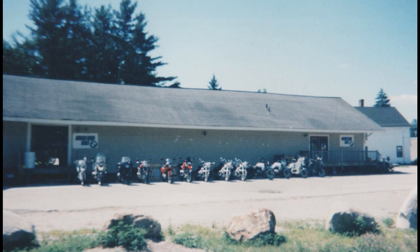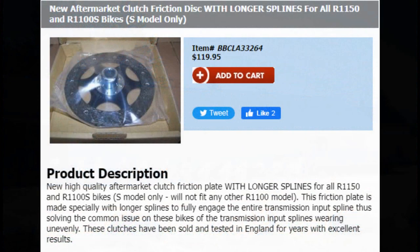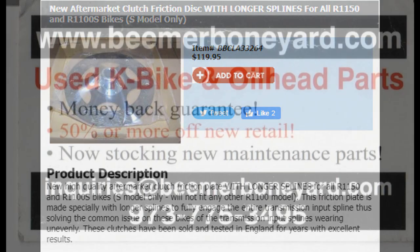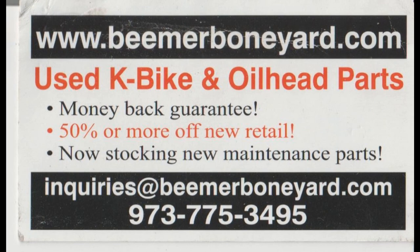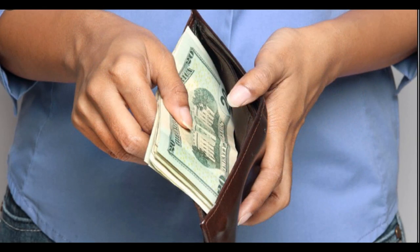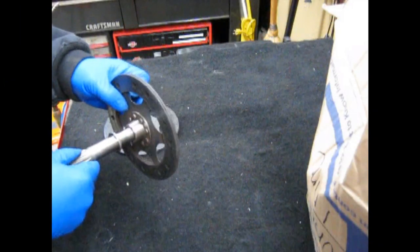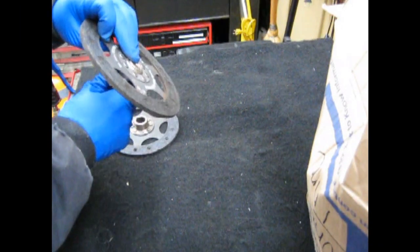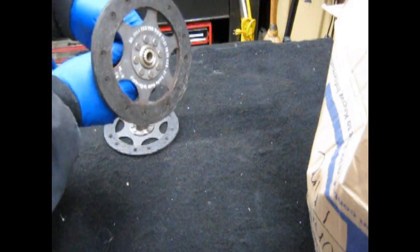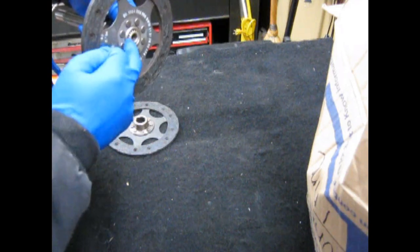That's why Bruno came up with moving the splines on the clutch hub so that the splines would have full engagement both on the clutch hub and on the input shaft splines they ride on. Bruno's not with us anymore. Rest in peace. But Beamer Boneyard has a solution to that, as seen here. That, in my mind, would help ease my worries if I were to be on an R1100S long term. Being a cheapskate, I can't afford to be breaking down somewhere across the country and needing to haul this thing back. Thank you, my friends. You'll see me again soon. Take care.